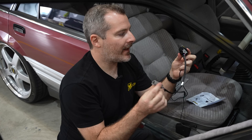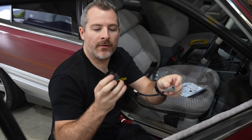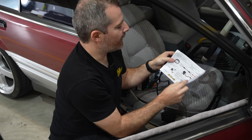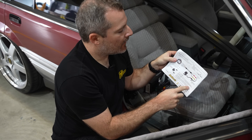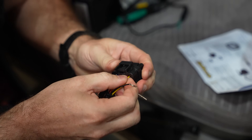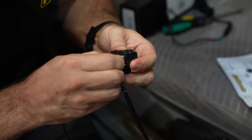I've pulled my camera harness through the interior of the car and I've also taken out my UC10 dash connector. This is the CAN cable going to the ECU and this is the plug out of the back of the UC10. I'm going to look at my quick start guide and follow the instructions on which pin goes where. My white wire for the reverse trigger I'm going to put into AVI4 on this specific dash. With all my wires on, let's get this plugged back into the back of the UC10 and then we'll jump into the NSP software to set it all up.